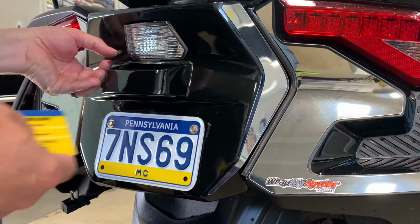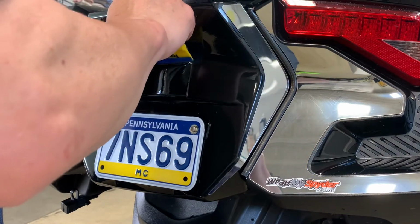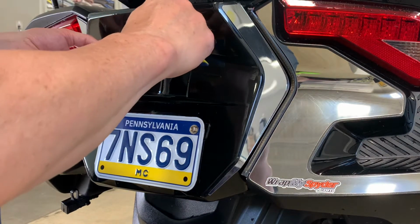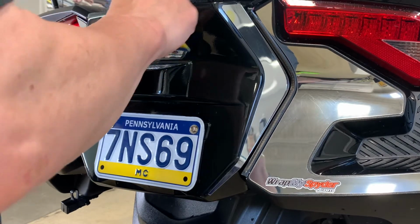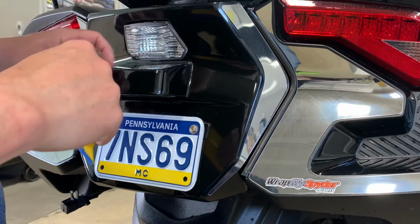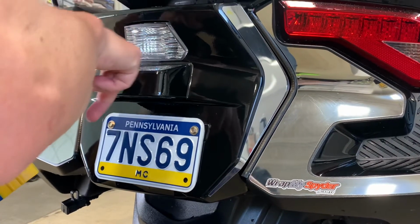I just tacked this top piece of reflective in place. I have my squeegee now. It's very lightly tacked. I'm leaving it in the air. You can see I have my finger holding the film in air. It's always best to do that, because that's going to prevent air bubbles. And then you simply squeegee the product on, just like you would do normal wrapping film as well.